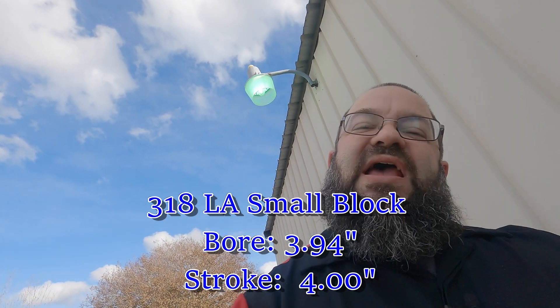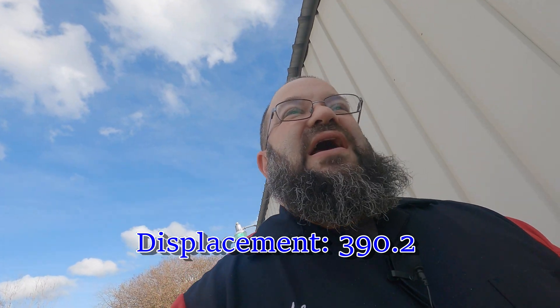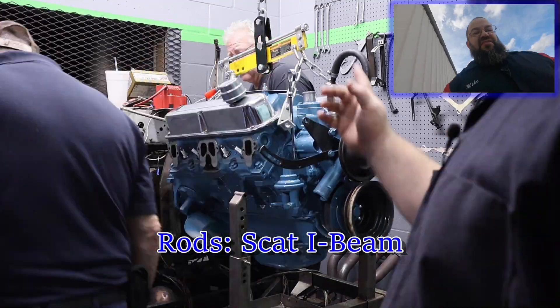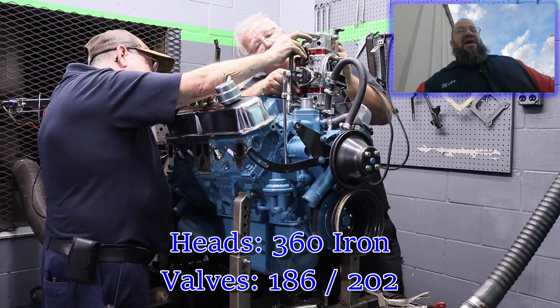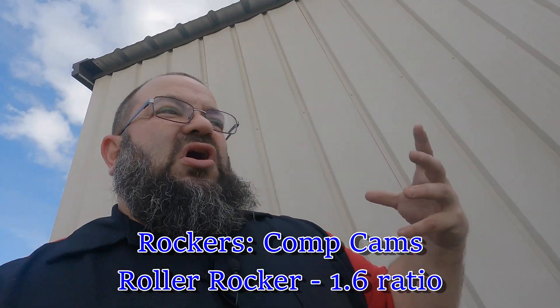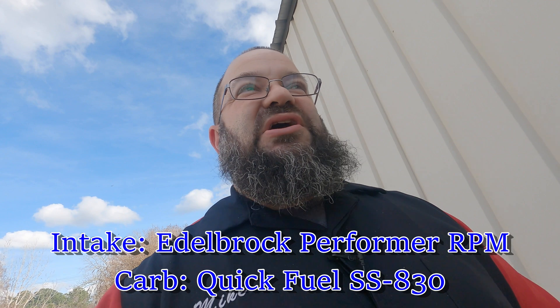This will be going into project Fast Fish, and I am really looking forward to it — I'm hyped up because I'm curious to see what kind of power it makes. Pop is thinking about the 425 horsepower range; I'm thinking in the 400s but not as high as 425. The specs should be running in the subtitles on screen. It's a pretty stock motor — nothing fancy. It's a hydraulic cam, flat tappet, broken in, hydraulic lifters, and steel heads. We're going to find out if it can turn 6,500 RPM range like Crane is advertising. Let's get started and hear this thing run.